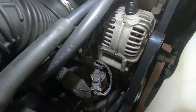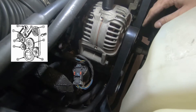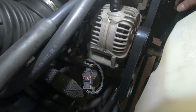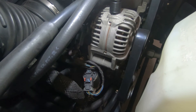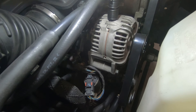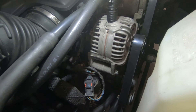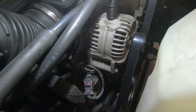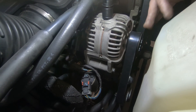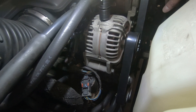As far as the belt diagram, I'll put a picture on screen and a link below for the routing diagram — it's pretty easy and straightforward, you can do this yourself. A squealing belt most times is just worn out — they stretch, dry rot, and crack. I don't recommend belt dressing; it dries out the belt and coats the grooves. Just change the belt — you'll prevent more problems later. For tensioners, if they're original at 177,000 miles I do change them, but this one had already been changed and the bearing was good, so no need.